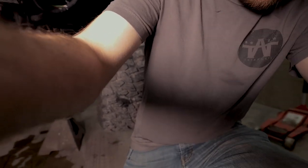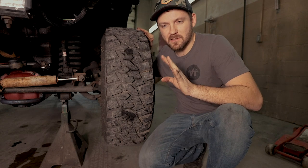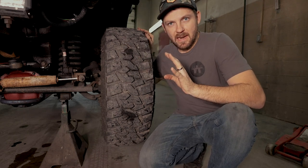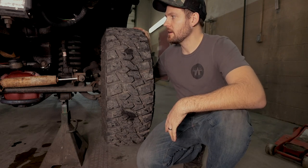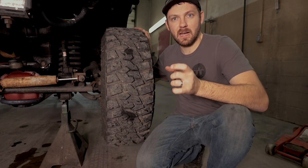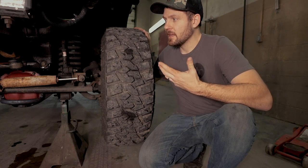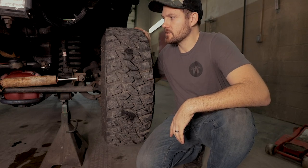Now ball joints, U-joints, all that stuff used to be a huge stressful event for me way back when I just started wrenching. A lot of that was because of lack of knowledge — I just didn't know how things went together, didn't know what to expect. It's actually a pretty easy process. You rip off your wheel — just five lug nuts. Pop your caliper off, pull your hub out, which is only three bolts using a little 12-point socket. Then you slide your axle shaft out and tear into the ball joints. None of it is overly complicated, but we tend to overcomplicate stuff, especially when first getting into it.